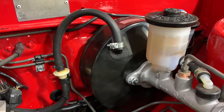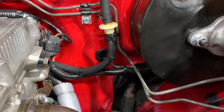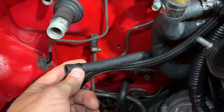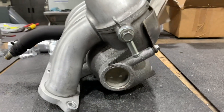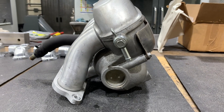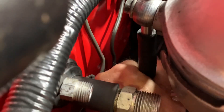For the brake booster connection, we used a standard rubber hose connected to the OEM check valve, then routed the hose down behind the engine and over to the intake manifold side. The brake booster connection on the intake manifold is on the back side up against the firewall. We loosened the banjo fitting and flipped it upside down for a cleaner look, then after the intake manifold is installed, we just slide the hose on.